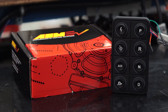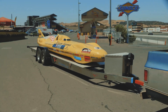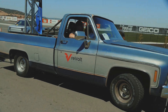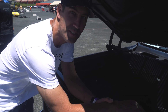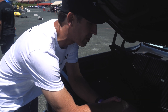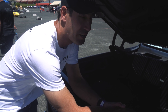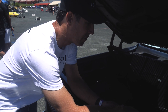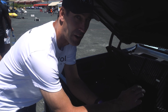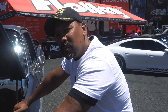That does basically everything. We really want to get a little more power out of it, and we hear that you guys are the ones that do that. I got enough battery in this thing to move a building. The battery in this vehicle actually came out of the Little Giant Triple Four car, which is the fastest electric car on the planet. That battery was designed to sustain 3,000 amps to motors. Being able to hit something with that much voltage on a motor like this, it's only using half the amount of current — we barely even saw a voltage sag yesterday after full power. Wow. So with your guys' new controller, we can really see what it could do, because I don't know anybody that's run a battery this stiff on an LDU yet. I'm expecting anything over 10 seconds in a quarter and I'm going to be disappointed.